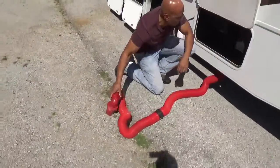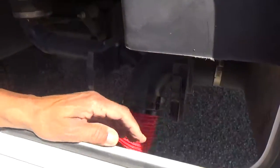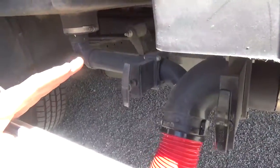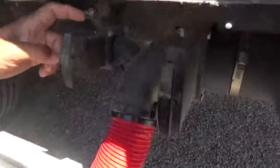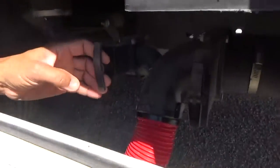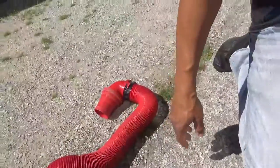Once the hose is secured, you come over here and you've got two valves — a really large one and a really small one. The large one has a black handle, the small one is gray, but they may not always be color-coded, so remember it as biggest and smaller. With your hose in place and secure, pull the large valve straight out — that dumps the sewage and toilet waste through the hose. Once it's done, shake your hose a little bit, push that valve back in, then come to the smaller one and pull it straight out. You don't need to turn it, just pull it straight out — that drains the sink and shower water, which runs through the hose and rinses out all the toilet waste. You must do it in this order. If you don't, you'll regret it — I promise you.